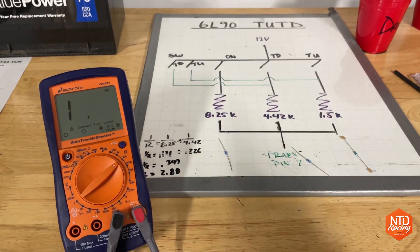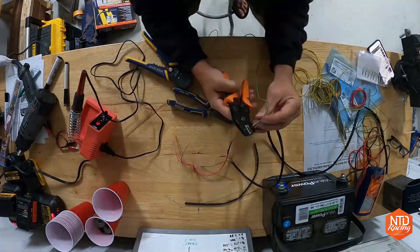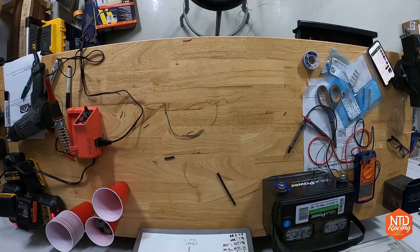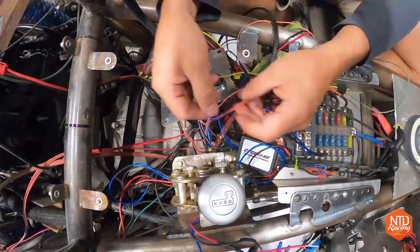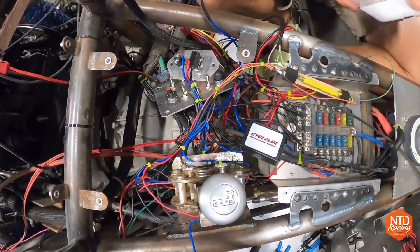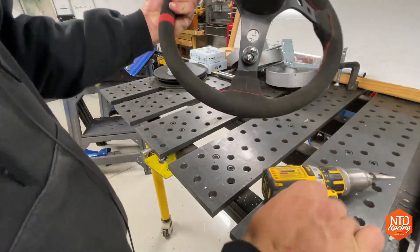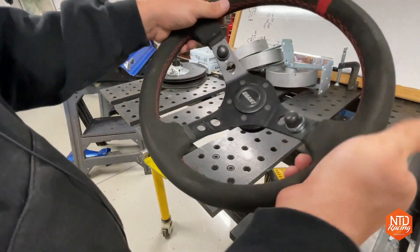Let's go ahead and build the circuit and put it in the car. The wires I'm using are really small gauge — maybe 20 or 22 gauge — wires I pulled out of the harness when I gave my LS engine a harness diet. There's not a lot of current going through these; remember it's just a signal reading a different resistance as it goes into pin seven. I used a drill to open those holes up and got the buttons in there, so now while you're driving you can shift up or shift down right on the steering wheel. Pretty trick.